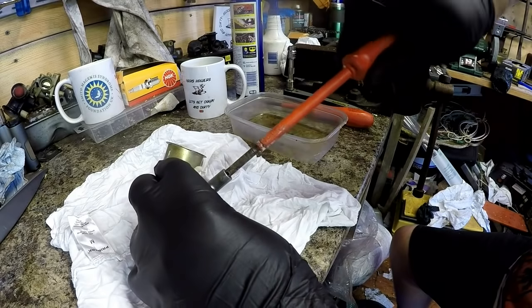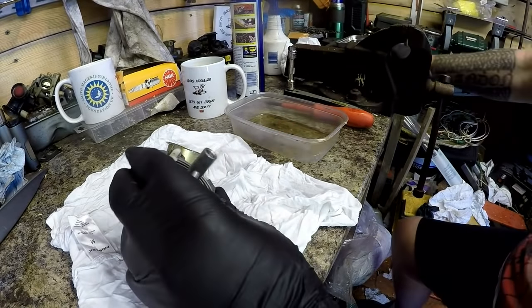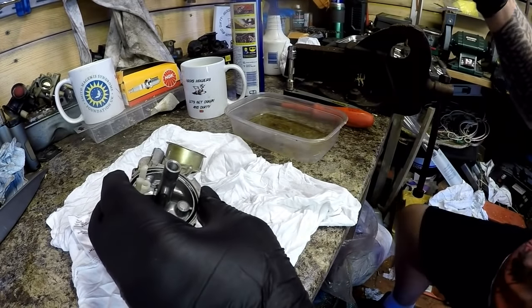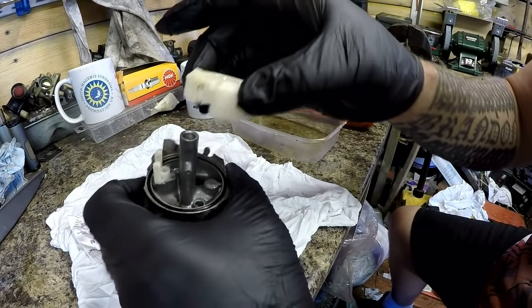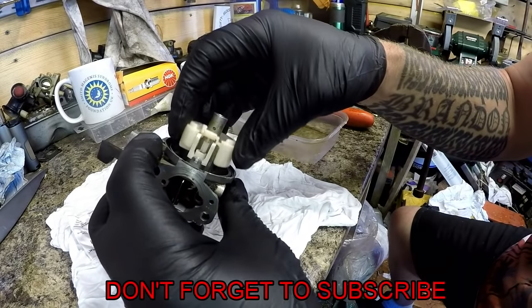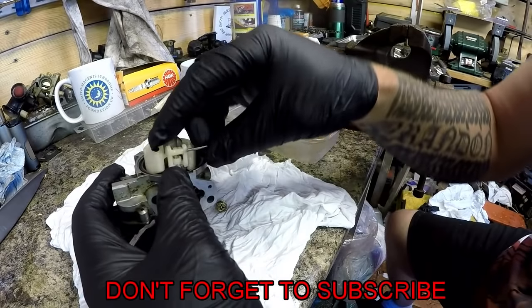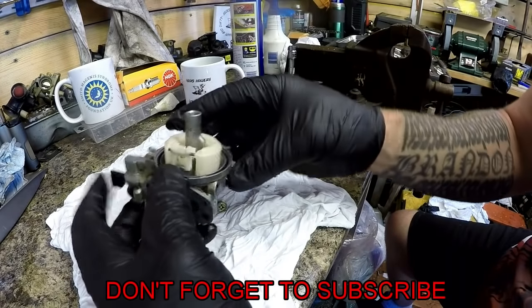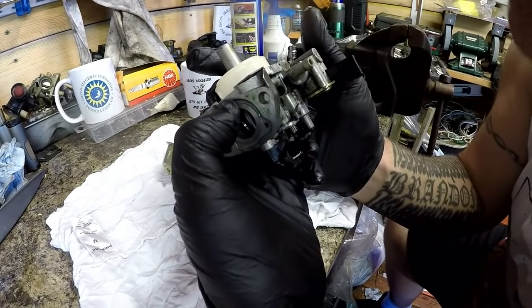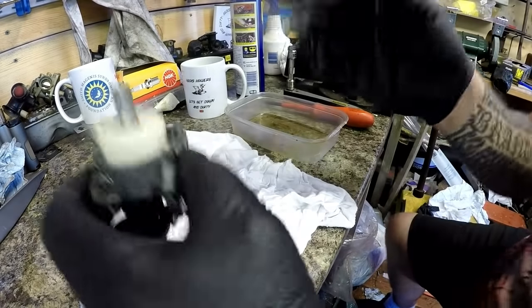As I say, if you have seen me do this before, you can just fast forward onto the next video clip. That's that. Bring the float in, which is clean. No dirt on there, and that just sits in the hole. In there, get the pin, feed it through, and then you can just blow through here. No air. Lift the float up, and you can hear the air going through, so that's working.